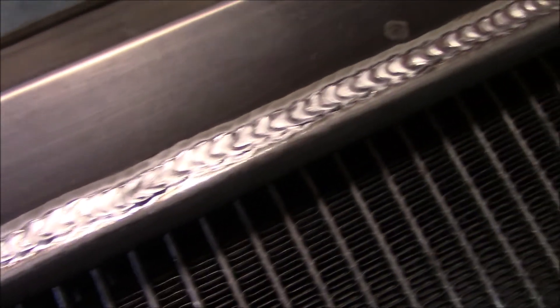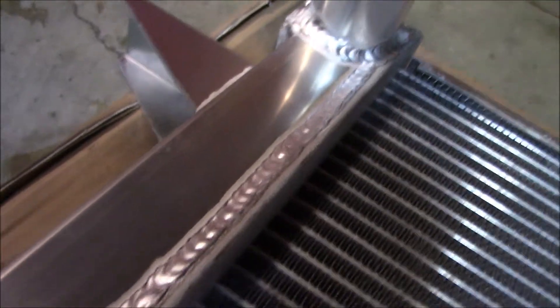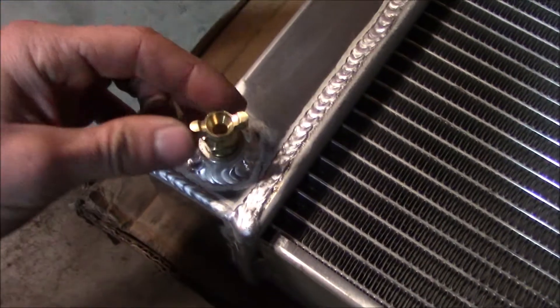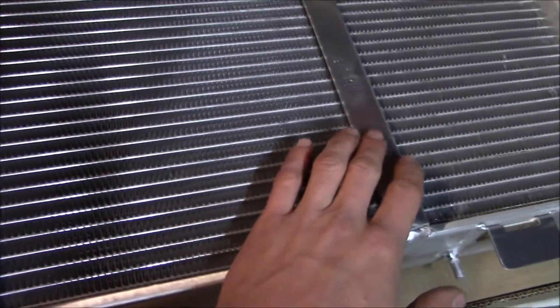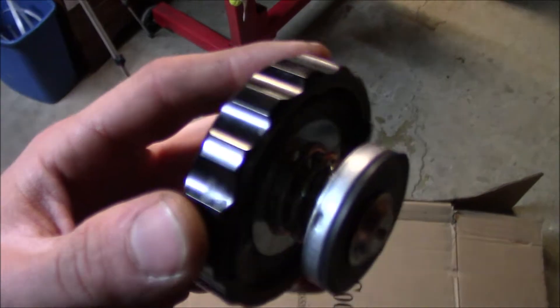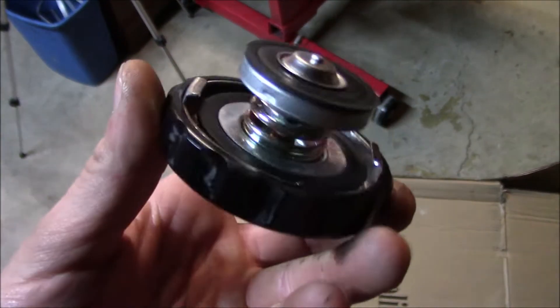The welds appear to be of pretty good quality — don't look too bad. I'd imagine they probably pressure test these. It's got a drain petcock, and this one's brass, which is kind of a pleasant little surprise. The stanchions in the middle here are an eighth inch. That is what I would call some increased volume there — very nice. It's got a threaded nipple on it for the overflow tank. I am pleasantly surprised with the quality of the cap — this isn't even plastic, all of this is metal.